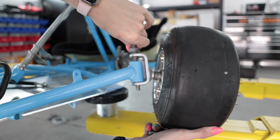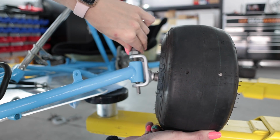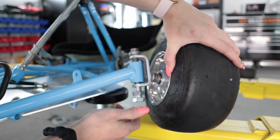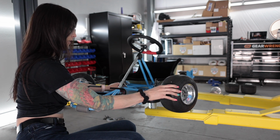I'm back with the parts. Try this out. The tricky part is this threaded body has to only contact the center of the bearing or else the bearing will not rotate, which it does, so that's good. Just like that. Look at that. No wobble or play. Hey, there's a rock stuck inside that hole. That's gonna bother me. That's good.